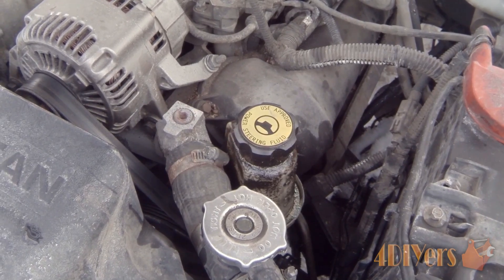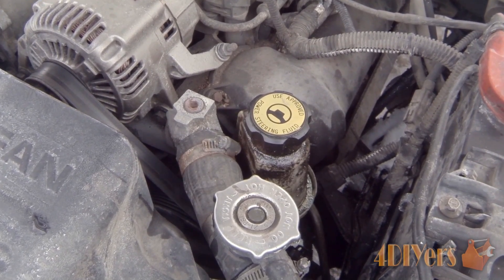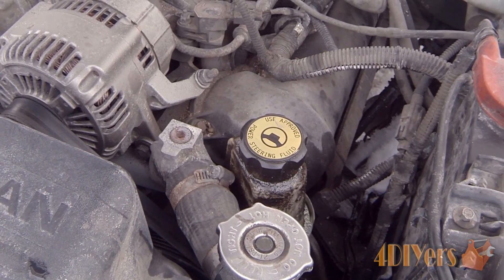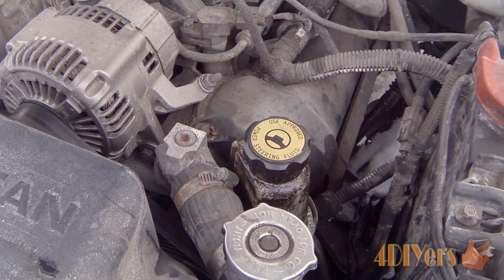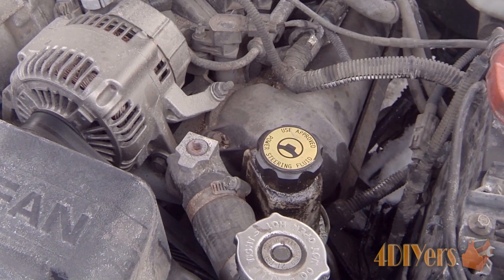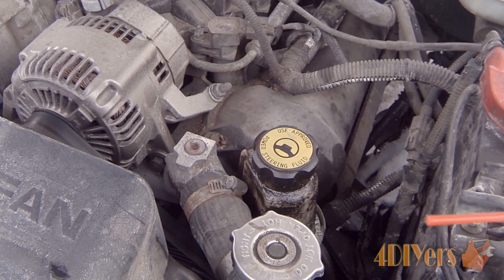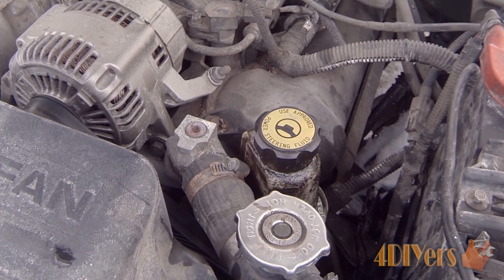In an older video I did on replacing the steering rack on my Volkswagen, the rack failed because the seals where the tie rods go in were worn out. The tie rod shafts get pitted over time and start to rust, which wears out the seals and the fluid starts to leak out. Another common issue — especially on Dodge trucks — is with the cap: there is a vent built into the cap. When the system is running, fluid heats up and expands, creating an air cavity that needs to be released to make room for the extra fluid. That vent gets plugged up over time, which can cause leakage as it builds excess pressure that goes to the next weakest point. You can either clean the cap or purchase a new one.